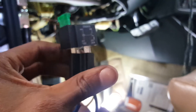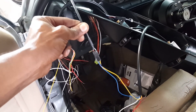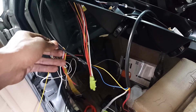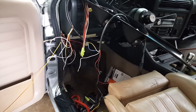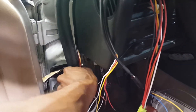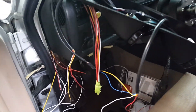This specific type of relay has a fuse built in, so it's a fusible relay, which makes things a lot simpler and easier. I've got the MAP sensor for the boost gauge fished through, and I have all the wires that I'll be wiring up the gauges to fished through as well. I'm going to start lining them up and then soldering them — I have a good amount of room down here.